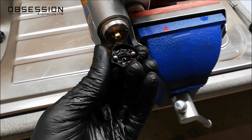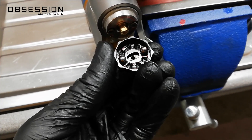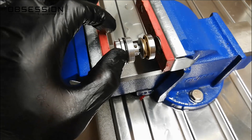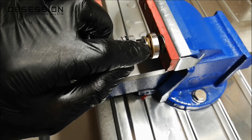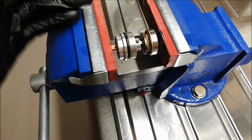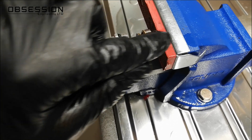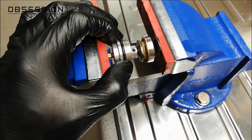The first thing you'll notice inside the adjuster cap is two ball bearings, a load of holes, and some little springs. As the ball bearings run into the holes, that's what gives you your clicks. What we have here is the rebound piston and shim stack. There's a spring and a check plate, so that when oil is flowing in compression it can be pulled back through these big holes with no resistance. Then when oil flows towards the rebound stack, the non-return valve closes, and oil is forced through the piston and under these shims that bend open, giving us our damping properties. The faster the shock moves, the more the shims are pushed out of place, and that's how much damping you get. There's also a little bypass hole, and the adjuster — a little bit like on the conventional shock — just opens a bypass through the middle of the piston, giving you your click adjustment for how much oil flows through the shim stack.